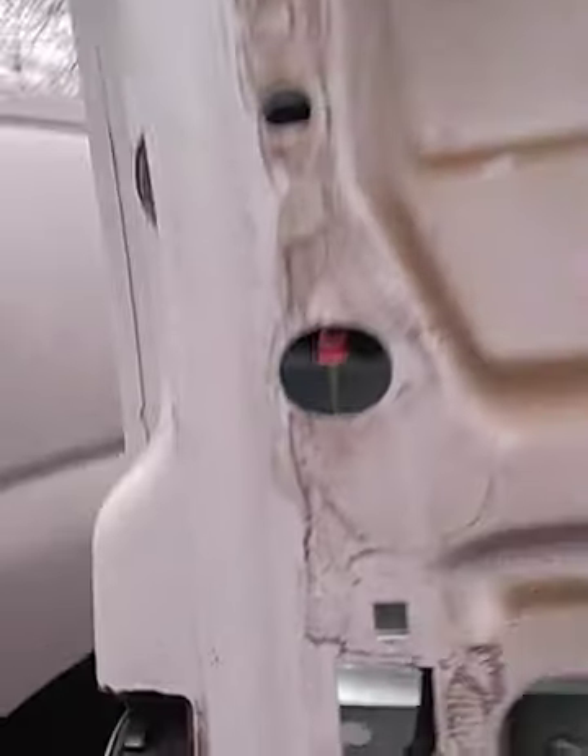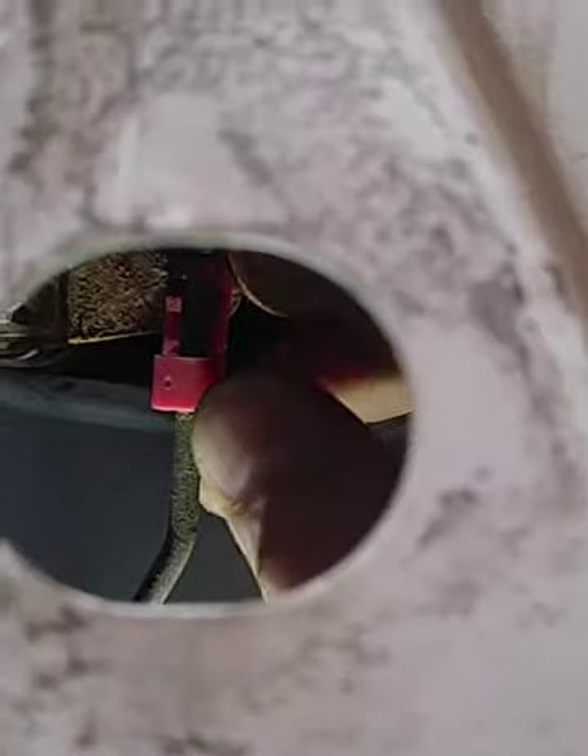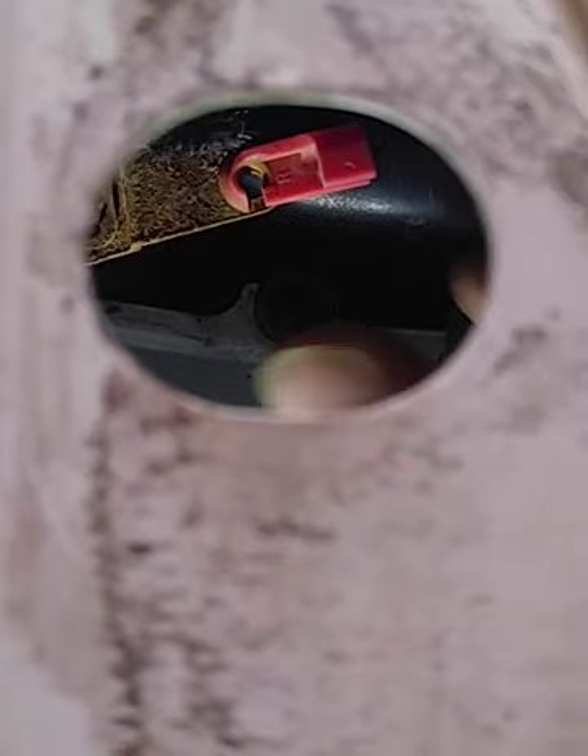I've got my flashlight inside there so I can see better. Come down to this hole — you can look in there and see your lock cylinder. There's a red clip you have to take off right here — just pull it this way and it pops off. Then you've got to pull this rod out — it's connected to the cylinder — just pull it back toward you and set it aside.